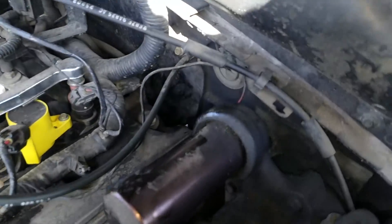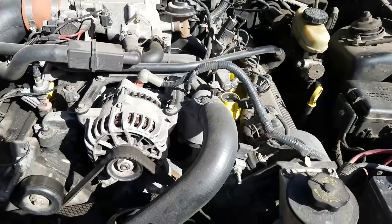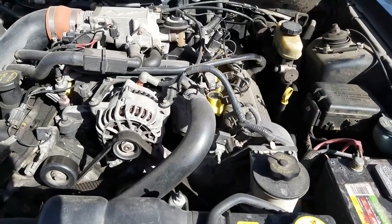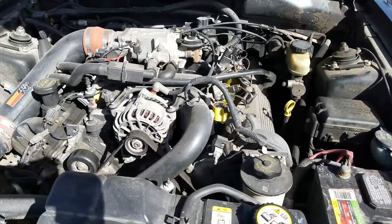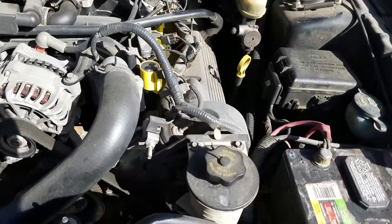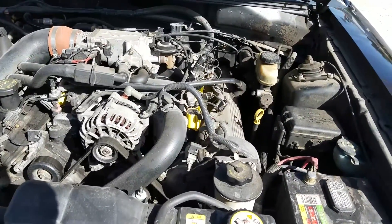We're going in behind the engine. You see this hand here — that green thing? That's what it's got to go into. That's a nightmare — it's very tight, unless you want to take the whole engine block out. While the wife is zip-tying the sensors there — it's a little bit longer than the stock one, so it comes with a zip-tie. Don't forget to put some anti-seize on the threading as well. That exhaust is probably the hottest component in a car — the last thing you want is for it to seize up, and then you will need to invest in a blowtorch.